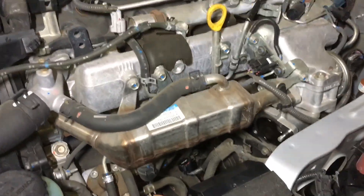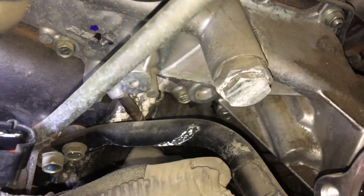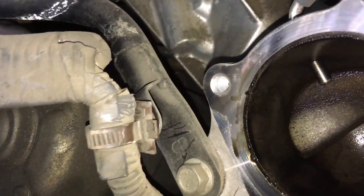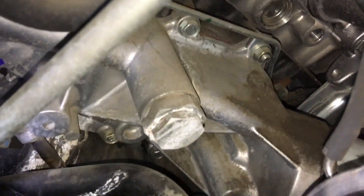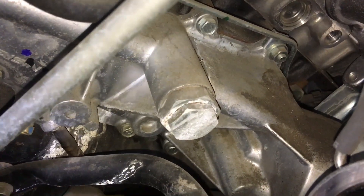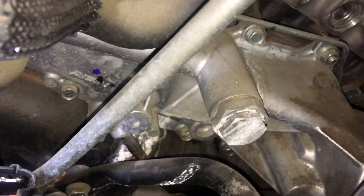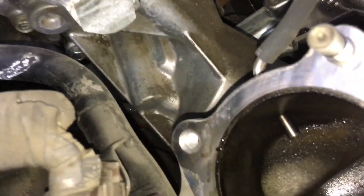Throttle body off. Let's go and see if we can get the camera in there and have a look at what this EGR valve looks like. You can see a bit of oil there. We've also spotted there's a coolant leak. See that coolant down there — it looks like from that bolt in the middle of the picture there's a little washer, and by the look of the corrosion around it, it's dripping directly onto the stay. Only a minor leak, hopefully only a minor repair.